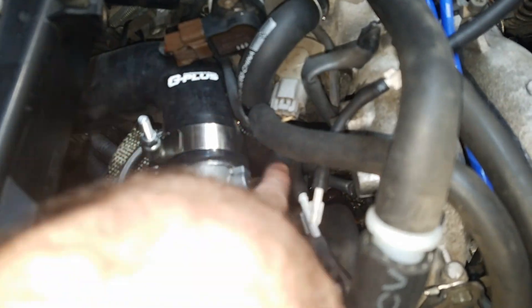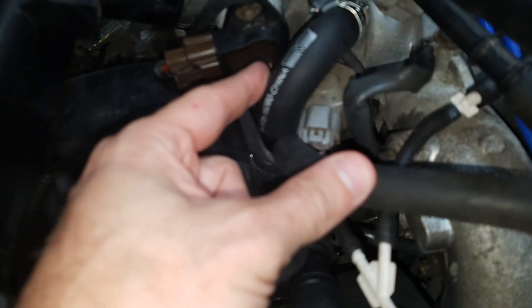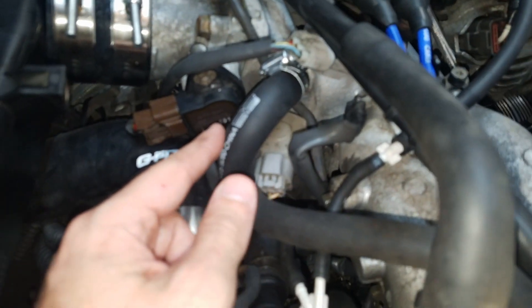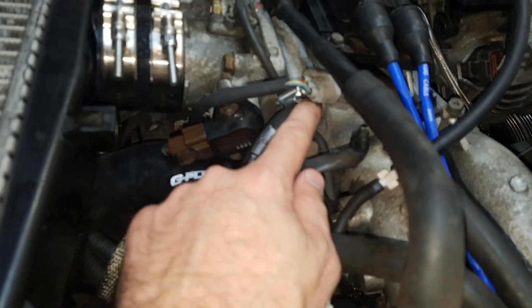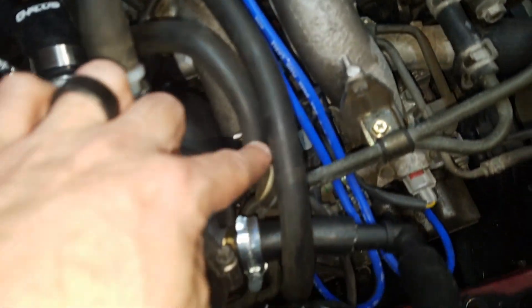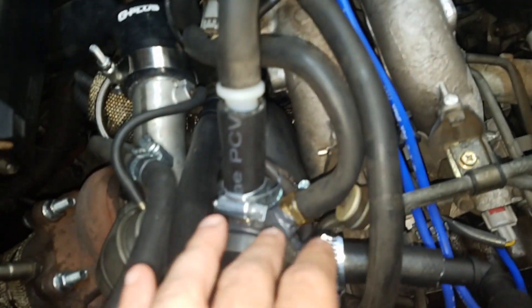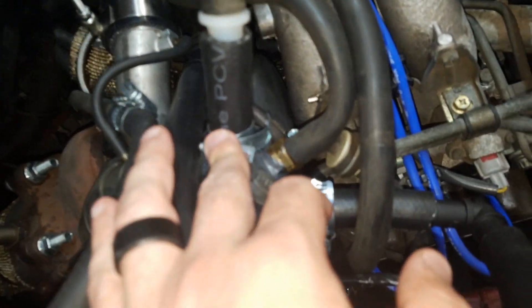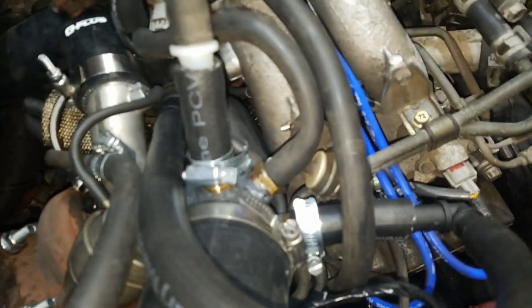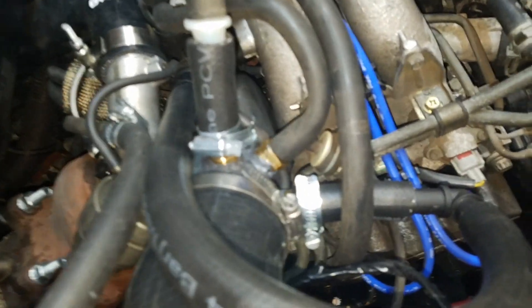Take the three-quarter inch hose off of this from the stock one, put it on the crankcase after you take that hose off there — it goes down like this. Cut the excess off until it comes up right about to the idle air control. That's where you're going to be using this adapter. It comes up to about right here, and then there's a Y — a stock Y that I used. Part of it goes to the PCV right here. Make sure you put a hose clamp on that. And the other part goes to the intake. Keep these separate — don't try to do it all in one nipple. You'll regret it — probably have some idle issues.